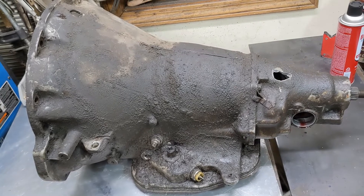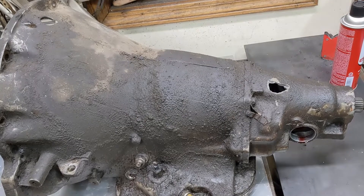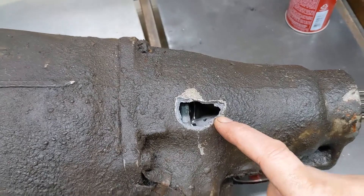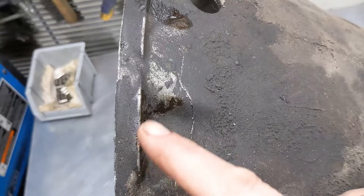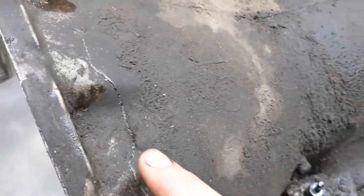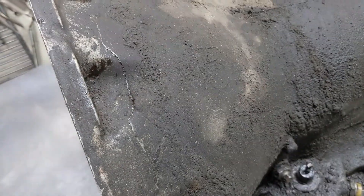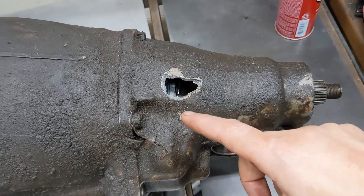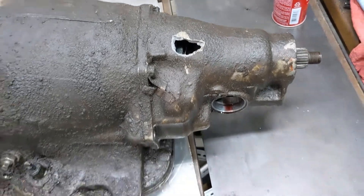The 727 was in a moving vehicle. Evidently it all of a sudden made a thump sound, the rear tires squealed, and then it puked all of its fluid out onto the road. I can see why that might have happened. During disassembly somebody didn't take off all of the bell housing bolts and tried to pry it out, so you can see it cracked the case here. I'll probably try to repair that at some point, but not in this video. Right now I'm more interested to see what happened here. Looks like the governor came apart — maybe a piece got wedged in there and popped out through here. Let's get it apart and see what's going on.